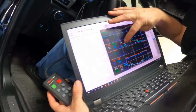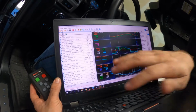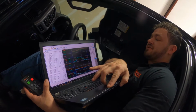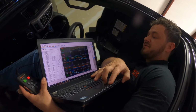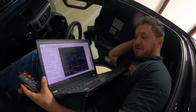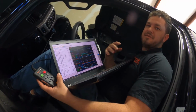See that white line is your ignition advance, and that green line is the throttle, so that's when you start the pull, and the timing drops down to 3 degrees after top dead center. Then, about 5,000 RPM, it starts sloping timing back in, but at that point, the temperature's high enough that it's starting to knock a little bit. Oh, okay, so the actual temperature kind of kicks in and doesn't allow it to perform. There's definite load limiting and torque limiting going on here, so it's closing down the throttle. Yeah. I'm not doing that, the ECU's doing that.